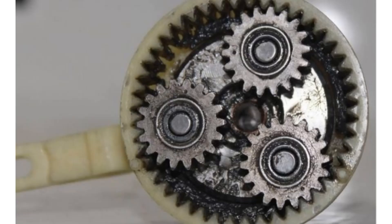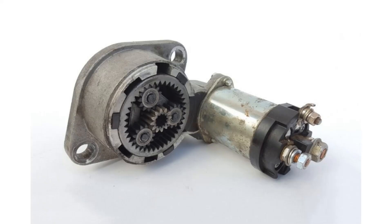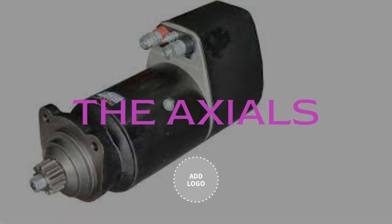There is a sun gear located at the end of the armature and three planetary carrier gears inside the ring gear held stationary. This motor is designed to offer less weight in its construction and less heat generation, because there are no field coils — the commutator and brushes transfer current directly to the armature.